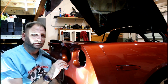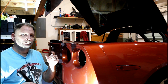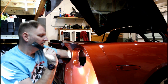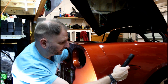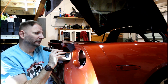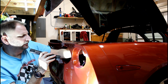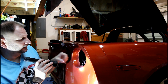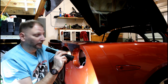That harness down here has a plastic rivet holding it in, and I can't release it from up here. I traced it back. Another harness, the side light right here, feeds into it. I can see the two wires in the back of this side light connector. It is a black wire and a brown wire. I found the harness. Here it is. It was clipped right here to this tail light. No other wires can be in this because they don't go anywhere else.